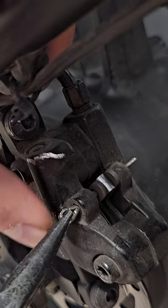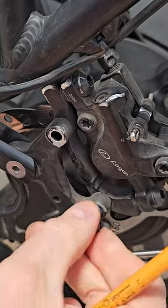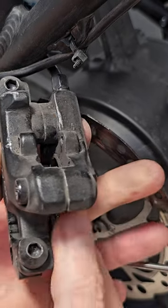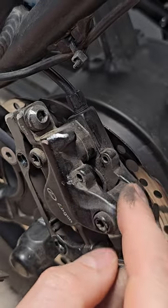It's done, but don't remove it yet. Now remove those two screws. Let's pick up gently the brake caliper, slide out the pin, slide down the brake pads. When you remove brake pads, don't squeeze the brake lever, otherwise you will damage your brake.